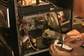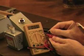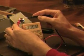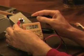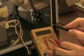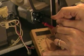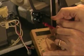For good measure, I decided to test the thermal sensor to make sure it was doing what it's supposed to do — it does conduct, which is correct; it should be a short because if it got really hot it would open up. This is also a test of the capacitor. A good capacitor will not show any conductance.